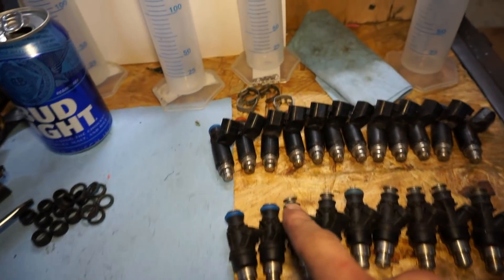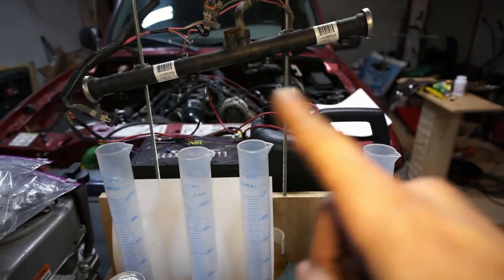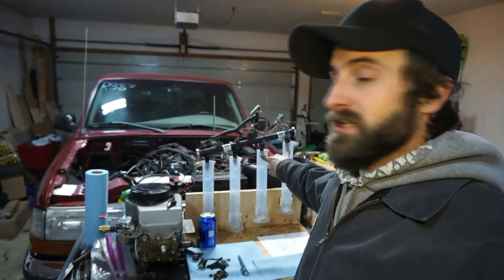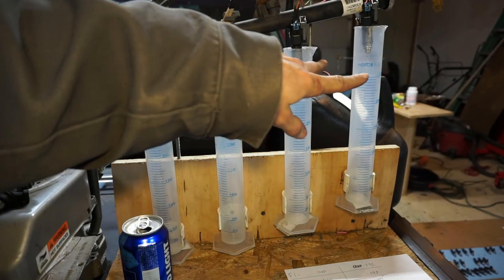All the regular truck injectors are decapped now, and the flex fuel ones are decapped too — I'm putting them in the rig. I've been at this about eight hours now. Got all the regular truck injectors done and a couple sets picked out. What I noticed about the flex fuel injectors is they do flow more but they're all gummed up — some I've had to run four or five times before getting a decent flow. Some don't even open; I have to push the pintle in or cycle them a few times to get them running and clean the crap out.